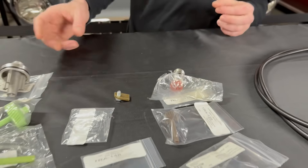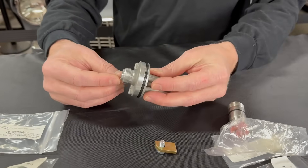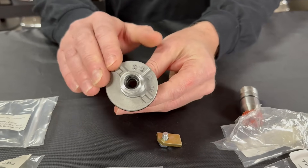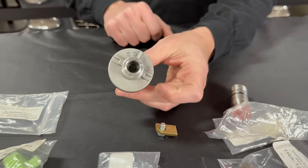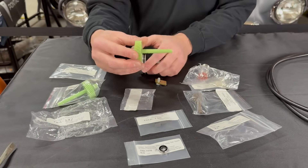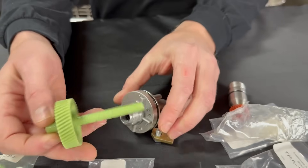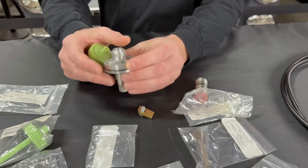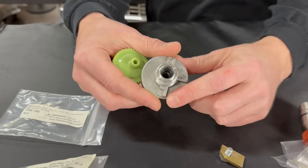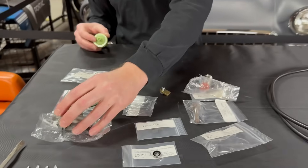Your Turbo 400, however, has a different fitting that you need to hold your speedo gear. These are also going to vary depending on the tooth count for your Turbo 400, so pay attention to that. You're going to want to count the teeth on your original gear and look at the color of that. On these fittings for the Turbo 400, it'll also tell you on the face of it which tooth count it's compatible with on that fitting.